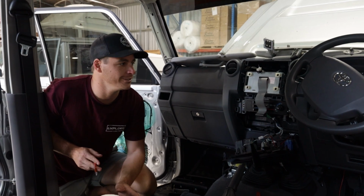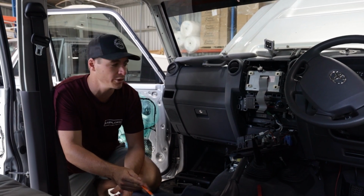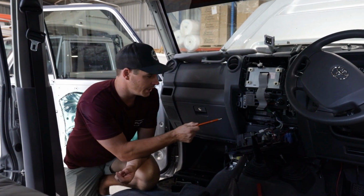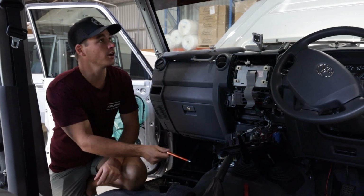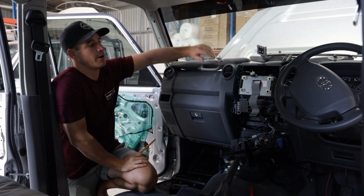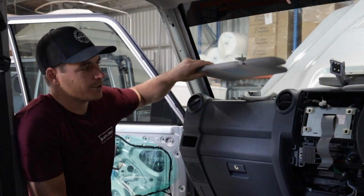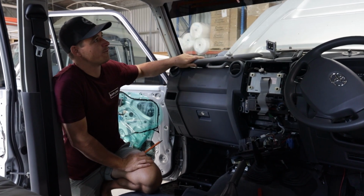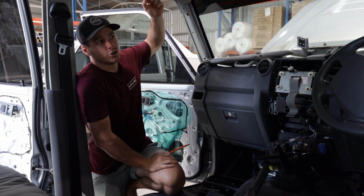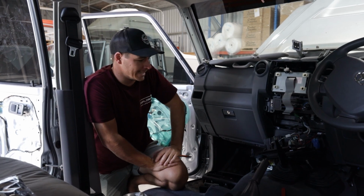Alright, so there's not too much that they leave in the interior. You wouldn't think they'd have to pull everything out, but you've got to rip all the front seats out to get this center console in with the fridge mount. The head deck's been completely pulled apart so that we can get into the rear speakers, and you've got to grab some power off the back here for your center consoles. They've run the roof power up the side pillar here nice and neat, so that gives me power up to my UHF up top. And all the sun visors come off because they use all the factory mounts, so there's no extra drilling or extra holes. They pick up a mount on your door handles here, and they use your visor mounts. So it's all super clean, no extra drilling needed. Yeah, good.